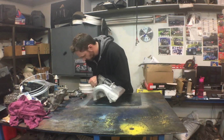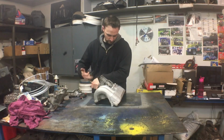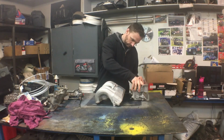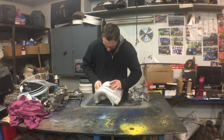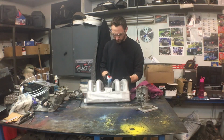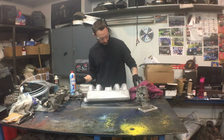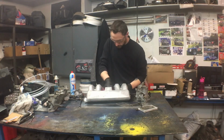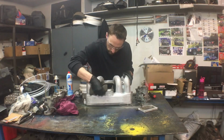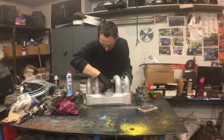It only takes 4 bolts and a couple hoses, and the throttle body is free from the manifold. We can then remove the throttle body heater, which is no longer needed. The intake plenum, as well as the runners, had a large amount of oil residue built up inside. I used brake cleaner and a rag to clean up what I can. I then scuffed all the gasket surfaces to ensure they seal back together nicely.